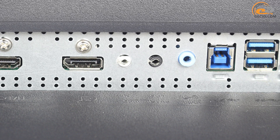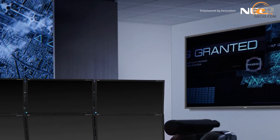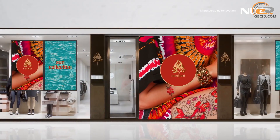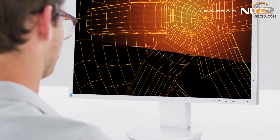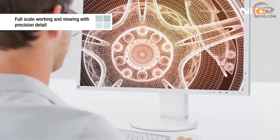The monitor's external interfaces include two 2.5mm control sync in/out connectors. The cable and connectors are designed for transferring settings to another monitor. It works in a very simple way: after a monitor calibration, you activate the control sync technology and the settings are automatically transferred to another unit and then to others in chain order. You can connect up to six monitors, saving time on adjustments if you want all of them to display the same image quality.